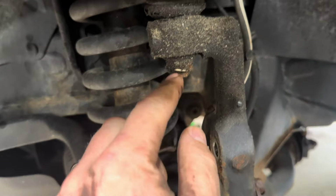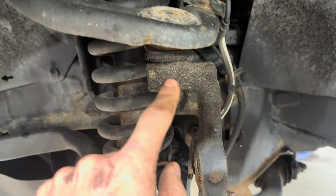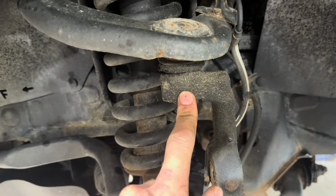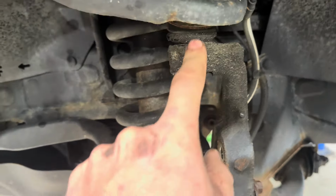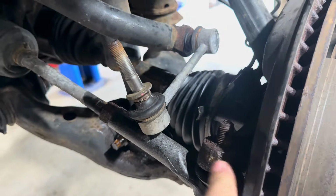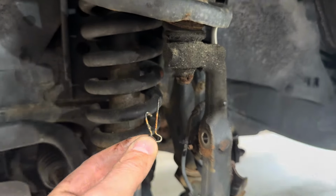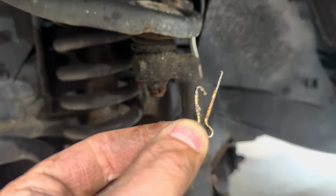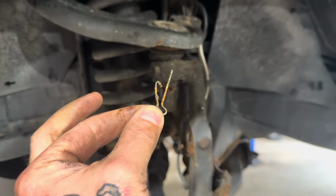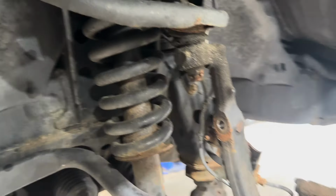We'll go ahead and loosen that, but not take it off, to allow some force pulling down on this. Smack this with a ball peen hammer, 3-pound sledge, whatever. Don't hit the boot. That'll break that loose. You're also going to smack this to break this one loose. That's that funky cotter pin type clip they use. These don't rust like regular cotter pins, so that's actually a decent setup. Let me go ahead and see if we can't get this nut cracked loose.